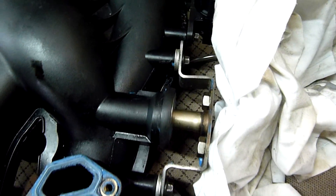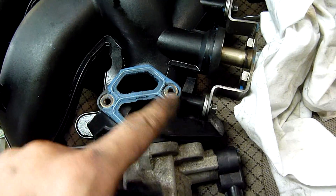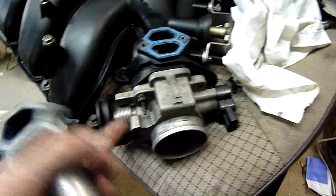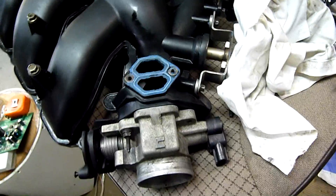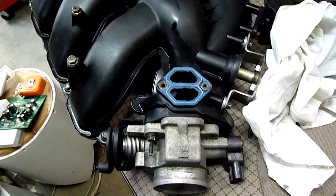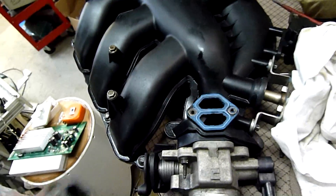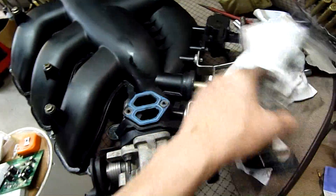The EGR is dealt with. The idle air control works fine - a bit of a mess of Blue Max on top of the housing but it was sealed 100%, so that can go back on. The throttle body seal on the front is really good - definitely not a problem up this end. I'd say it's either an injection issue, an ECU issue, or possibly an O2 sensor on that bank telling it to lean out. Kind of odd because it's only leaning out two cylinders, not three.